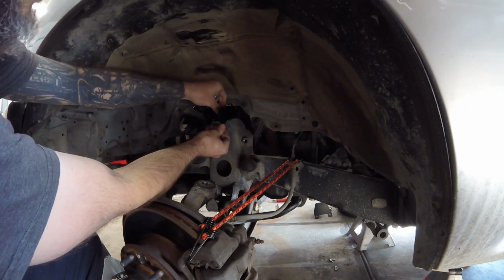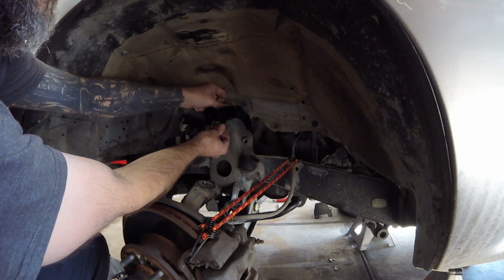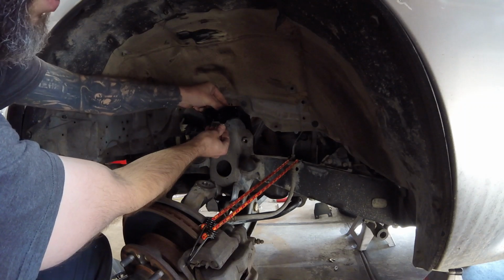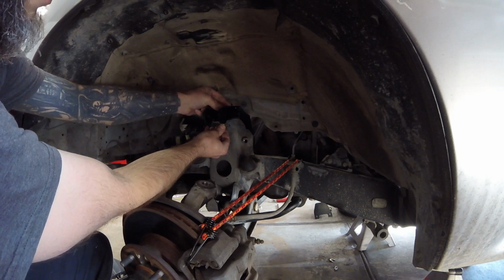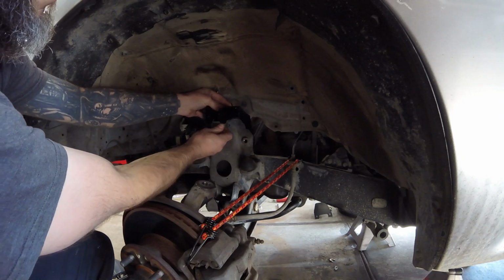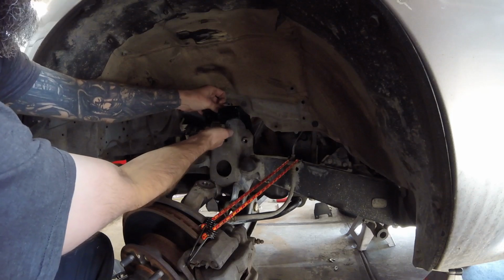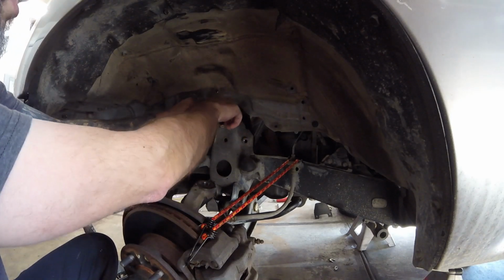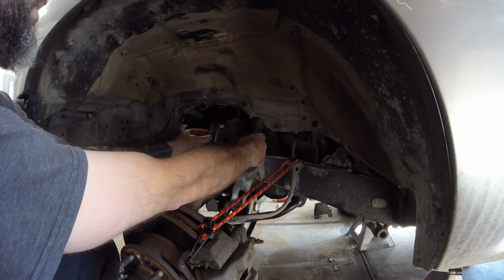The way I make these in the jig is that I tighten all these up and then tighten this one down, weld it, get some heat in it, and then bend the back plates so that it will clear a stock steering shaft. If you're running a rack and pinion kit, that's not an issue. But yeah, and that is the process. So that's how they go back together. This one always gets tightened first, and then your back ones will pull the plate in with the control arm.